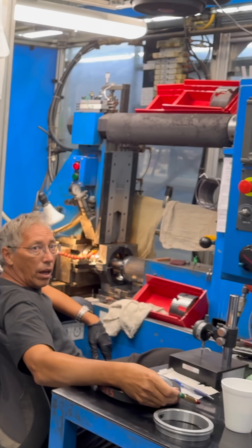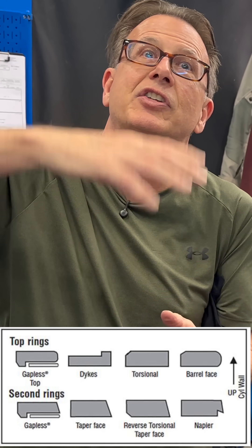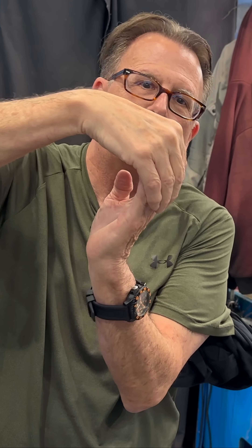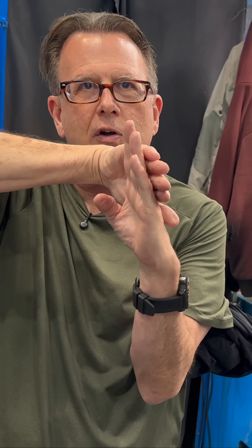Rings are not perfectly symmetrical. There's kind of a different side for how the piston is running, so there's lots of different shapes of the face of the ring. Typical top rings are barrel shape — they've got kind of a crown, and that allows the ring to rock over. As the piston hits top and bottom dead center, it has to rock; it's got to change directions and it'll roll on the wrist pin. We want that ring to be able to glide through the cylinder wall and keep contact. If it's flat, it's going to want to tip up and sit on the corners.